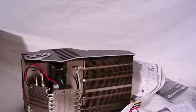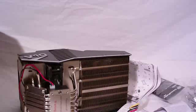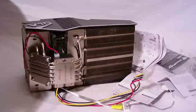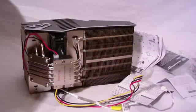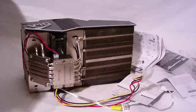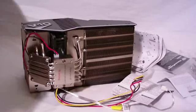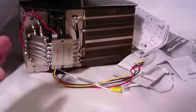TEC is intelligently activated once the CPU reaches extreme temperature — that's it. It's a unique triple heat sink with modular aluminum fins, dual PWM fans. They're 120x120x25mm fans running 800 to 2400 RPMs, with a maximum of 90 CFM. It works with LGA 1366, 775, and all AMD platforms basically, back to the 754. Well, that's it — let me take some pictures, get it installed, and I'll let you know how it works.